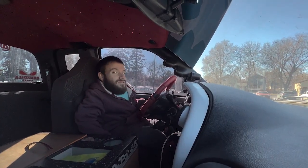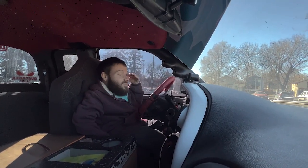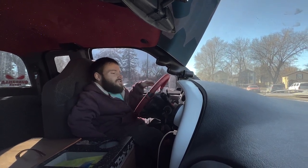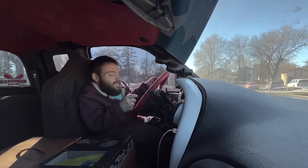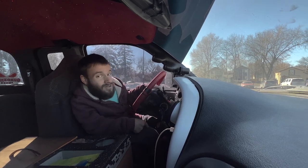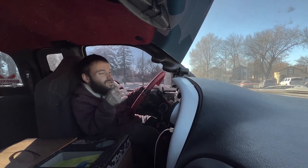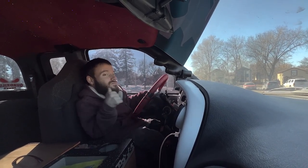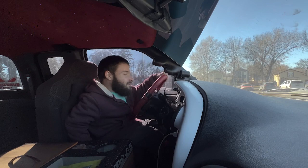Alrighty, I think I said that we had the leak because that clamp broke. But we fixed the clamp, we bled it all out again, turned the steering wheel back and forth with the front end jacked up, pressed the brake pedal a bunch in and out as well, because your Hydro Boost uses the same fluid to assist your brakes, and no more leaks. So far we are good.